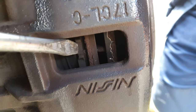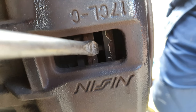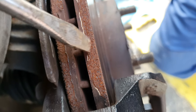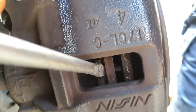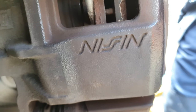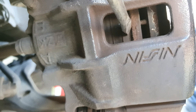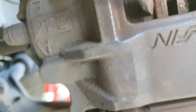So this is the piston, this is the inside pad, this is the disc, and this is the slot in between the disc. I'm getting my screwdriver in between the disc and the pad, and all I'm trying to do is push back that piston. There are different ways to do it, but this is one of the easiest ways - if you can get a screwdriver in there, you don't need your reset tool.